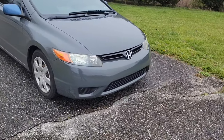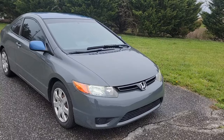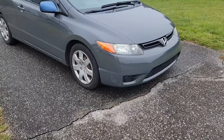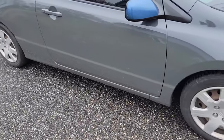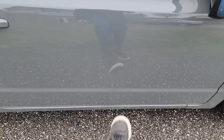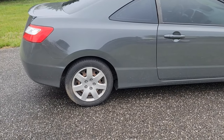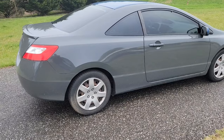I'm just using this as a daily driver, something to save up some money and pay off some debt before I get something fun again. You can see the mirrors and roof are still blue — I'm planning on painting those black and doing something with the hubcaps as well. For just a quick little garage paint job for real cheap, you can't even get your car painted at Maaco anymore for under a thousand dollars, and I did this at home with pretty good stuff for about $800. Once I wet sand and buff all this, it's going to look so nice. There's a little bit of orange peel because we were running out of pressure with the air compressor — I cheaped out on a 33-gallon compressor with only 11 CFM, which depending on what spray gun equipment you're using is probably not optimal.